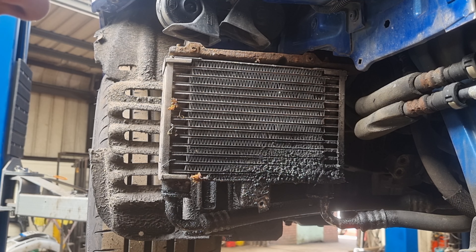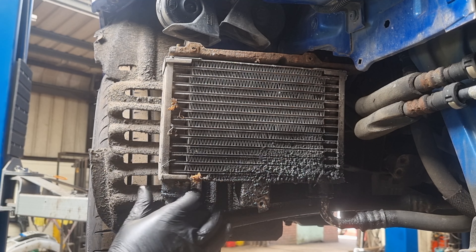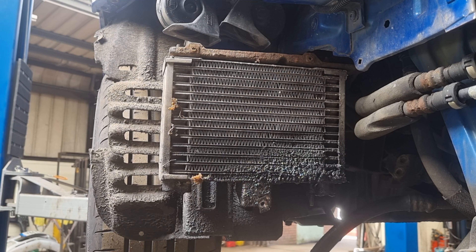As it's so covered in oil it does make it a bit easier to remove those little nuts. This is where we'll have lots of oil coming out - and I've made a mess on my floor already. I'll just allow that five minutes for the oil to totally drain out and then we'll remove the rest of the oil cooler.